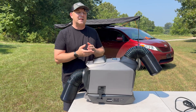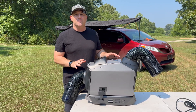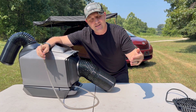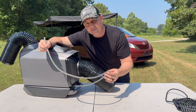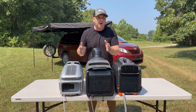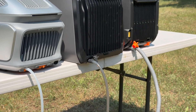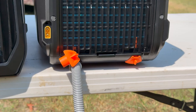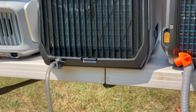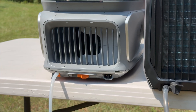The add-on battery can run anywhere from two hours on max mode up to eight hours on its lowest eco mode. The EcoFlow Wave 3 and the Zero Breeze Mark III both have active drainage systems with a pump inside, so when they fill up with water they actively pump it out. The Cybertake is gravity-fed, although it does have a low moisture control. All three devices have some kind of moisture control, but the moisture quickly overpowers these systems, so having the ability to pump away water is a huge plus.